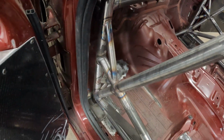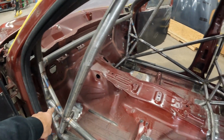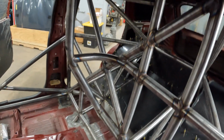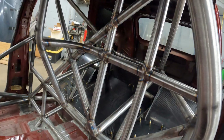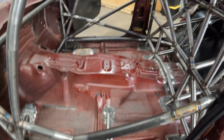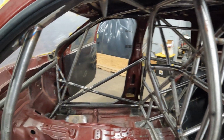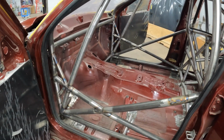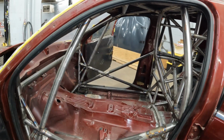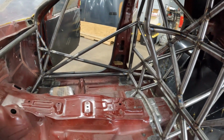This gives you a look at the cage. So with 25/6, you have this annoying bar that goes right down through the middle here on both sides. And you have this X brace that's in between the main hoop. But pretty much besides that, and the bar sizes being a little bit bigger, I think everything lines up with 25/2, which is a 6-second cert. So 25/2 with bigger bars and extra bars is what you've got with a 25/6, pretty much. That'll work out good for them because they can have this thing certed again for a lower cert if they wanted to at a later date.